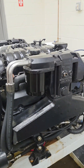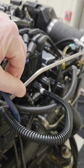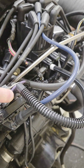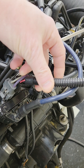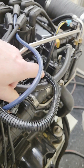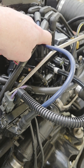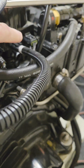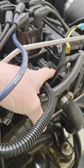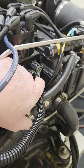I've got a MeFi 3 7.4-liter here, and the same thing - we have a Delco EST distributor here. The main difference is the coil is mounted a little bit further away, but the color codes stay the same: purple wire, gray wire, and on the other side pink wire and brown. The mag pickup creates an AC pulse signal that goes into the ignition module where it's digitized and turns into a square wave. That is then the RPM signal that comes out of these four wires over here, and one of those four wires goes into the ECM as the RPM input - that's called the reference high.